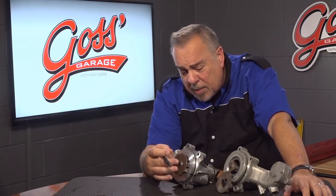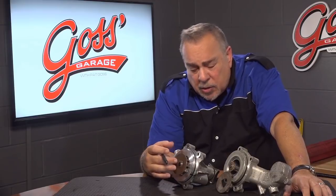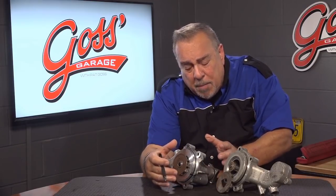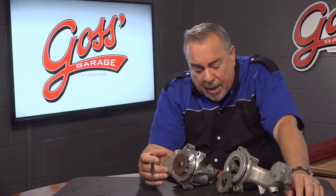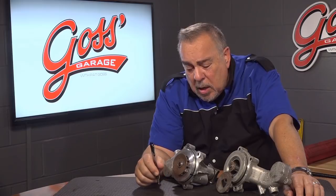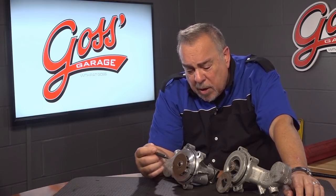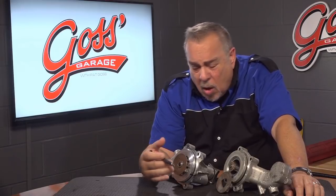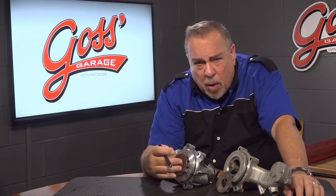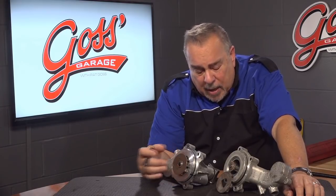You may have to remove the water pump to check this and do a visual inspection on it. With the plastic ones, you could use a heat gun to heat it and see if you can then turn the shaft inside the impeller. Checking the impeller can solve some really complex problems. We've seen cars come in with new radiators and all kinds of things where whoever had been working on it assumed the water pump was good, when in reality it had a bad impeller.